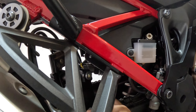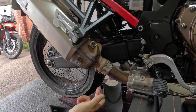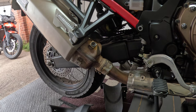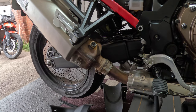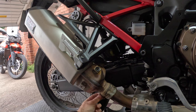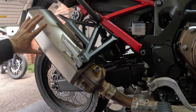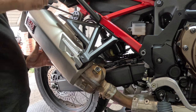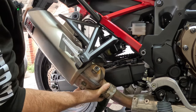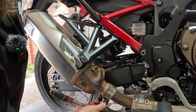We now have the large exhaust servo unit disconnected from the bike. We can go ahead and remove the rest of the bolts holding on the end can. Next job: undo these 12mm bolts here. Now that we have the clamp loose, we should be able to slide this one off. We just need to undo the rest of the way — this bolt is loose enough and we should be able to slide this whole unit away, taking the servo with us. It's probably been on there some time so it may need some wiggling — make sure everything is nice and loose.